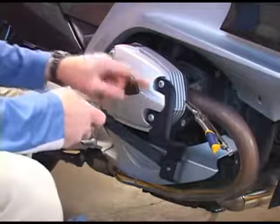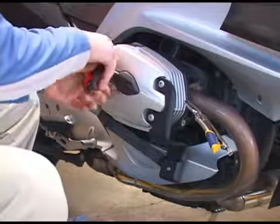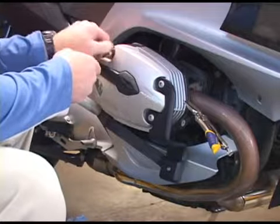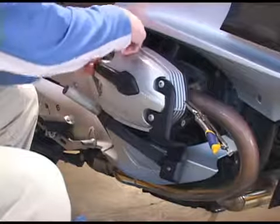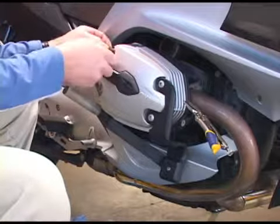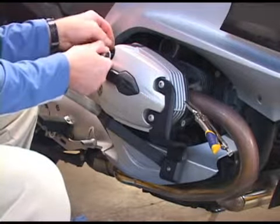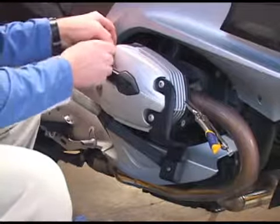Pretend that this rear bolt is one of the front bolts. I'm going to show you how to get the rubber off of the bolt — the shoulder bolt. There's kind of a cone washer on there that covers the rubber grommet. If you just pull out on the bolt, that rubber washer underneath will just expand and not want to come off very easily. So pull the washer off first, then just work that rubber with your fingernails and ease it out of the valve cover.